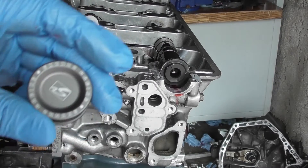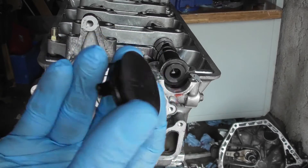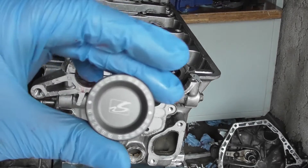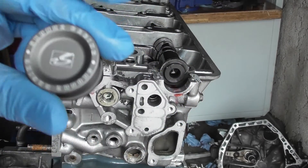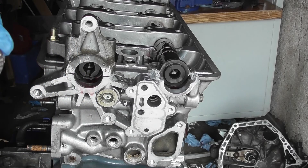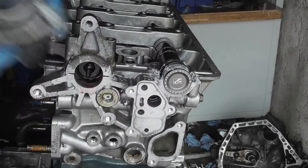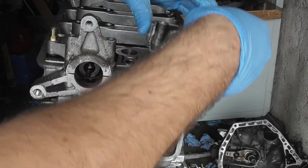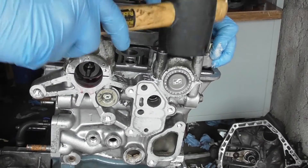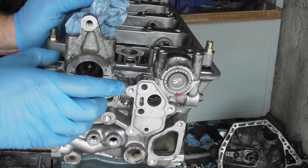There are two different types of cam seal you can use for the exhaust. Here we have the OEM standard one — if using that, just replace the rubber ring. I'm going with a Skunk2 item instead, which has three rings. Before going further, install Honda Bond onto the seal itself — this is probably overkill but better than having it leak. Place some Honda Bond here and here, get the cap in place, then use a finger to remove any excess ultra-grey that's seeped out the sides.